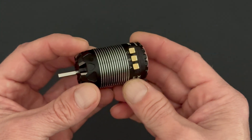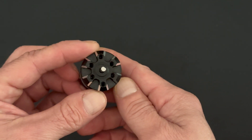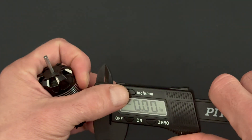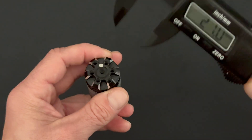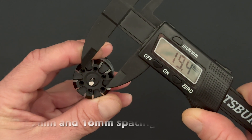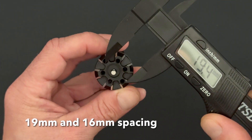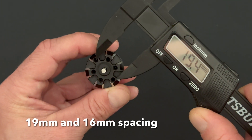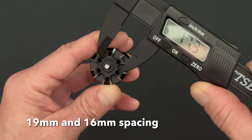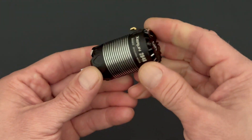This is a fully sensored four-pole motor. There's a sensor port on the back, solder tabs on the top with the A, B, and C phases, and it uses the full-size 1/8 inch pinion gear shaft, so it's easy to get pinions for it. Measuring the motor mounting holes, one set is about 19–20 millimeter center-to-center spacing, and the other set is more along the lines of 17 millimeter. Both of those are the same, so you do have some mounting options.